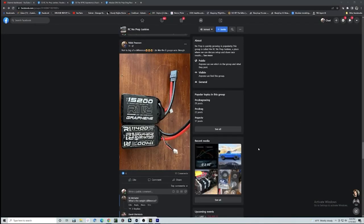The battery technology is definitely cool. I'm going to try going in the opposite direction — it was worth the $60–$70 to try out. Power Mad runs this thing and I still see him flip-flopping back and forth between the bigger battery and the small battery in him and his wife's car, and they both perform equally well. He's kind of our best tester right now — bigger battery like the Trinity I typically run versus this. This might not do as good in a car like mine since I'm at around 2,700 grams and his car is closer to minimum weight, around 2,200–2,300 grams.